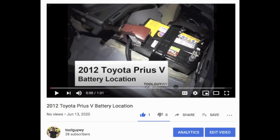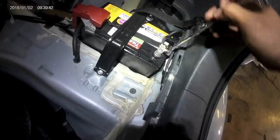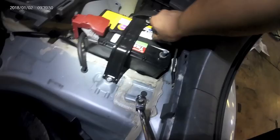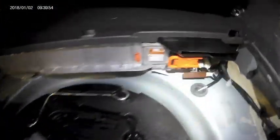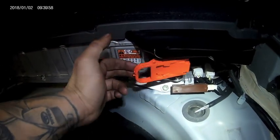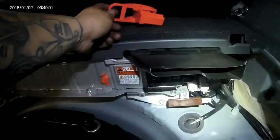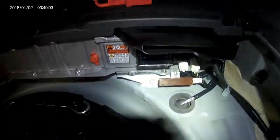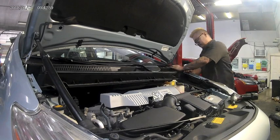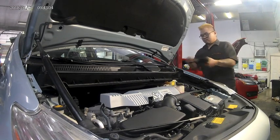Make your way to the back of the car and get to your battery. If you don't know where your battery is, I have a video on my channel and I'll put the link in the description below. Use your 10 millimeter wrench to loosen the negative terminal, remove it and put it to the side. Next, locate your service plug on the hybrid battery and remove it — pull left, then right, then back out to remove. This is an important step when working on hybrid cars and it is recommended to wait an hour before starting, so the hybrid battery can discharge and you don't get shocked while working on the car.